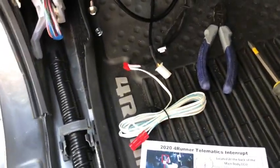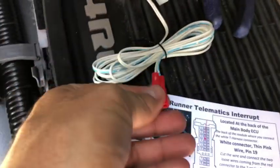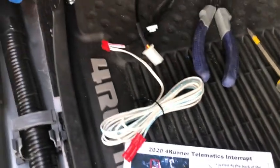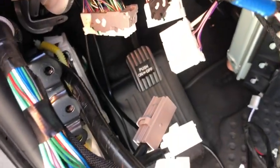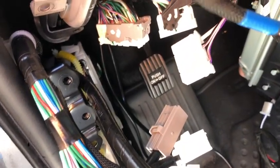The instructions say: cut the wire and the two loose wires from the red connector on the two ends of the pink wire — it doesn't matter which side of the cut wire. So I'm going to cut it and connect it. It doesn't matter, even though it has blue and white in here. I'm going to tap it in — not just splice it, but tap it in — and put some heat sealers in there, so it's going to take me a little bit of time, but I'll get there.